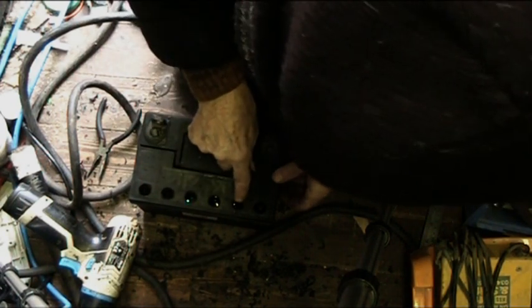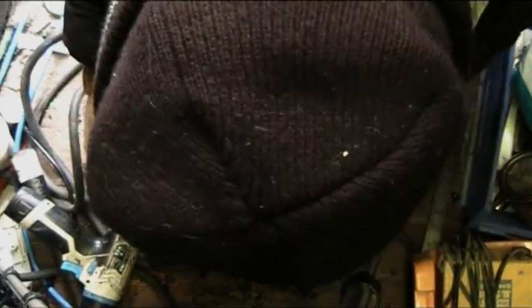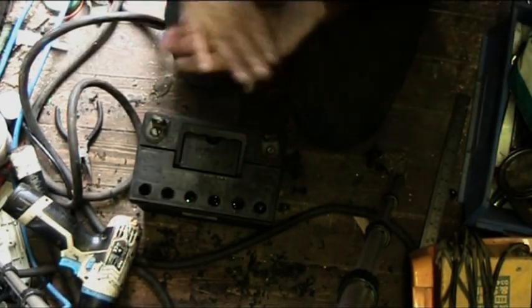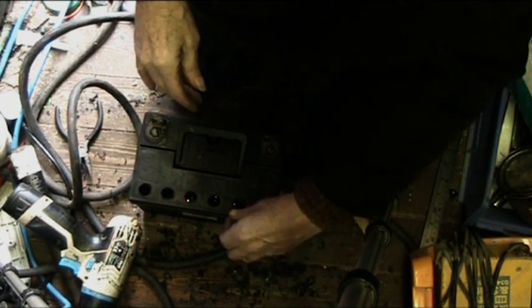But yeah, this cell is up. That one's just on the plates. That one's below the plate. That one's below the plate. That one, well, I can't even see anything from that one. So, not good. That would explain a lot. Not going to get in there much with that. But as I say, it will spew it out when you start the process of charging it.